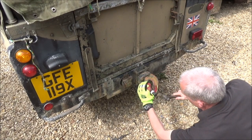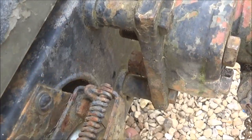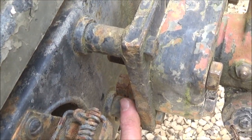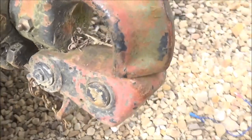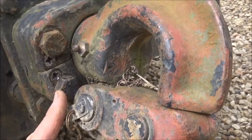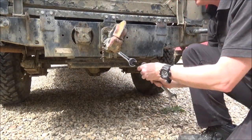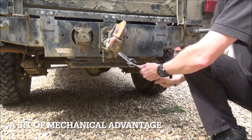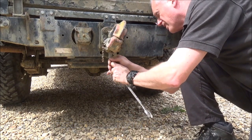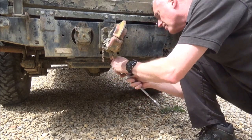A few good taps should free them off a little bit. As you can see just down here there's a double nut on this so it's not coming off. We need to try and work out how to remove it. I can't actually get a socket onto it so I can't put a big impact bar on it, so I've got to work from the back. Extend the spanner with another one and you'll find it a whole lot easier because you're using mechanical advantage.